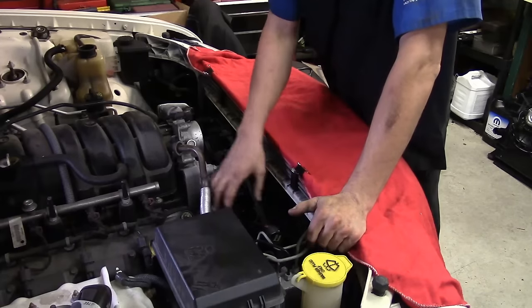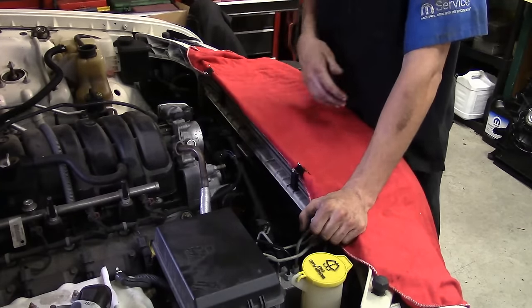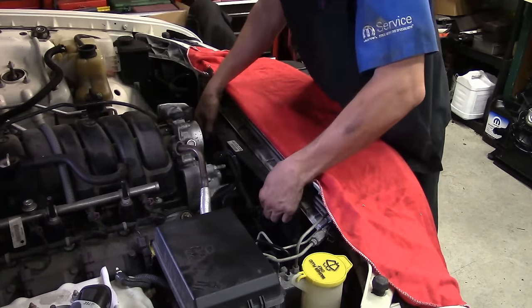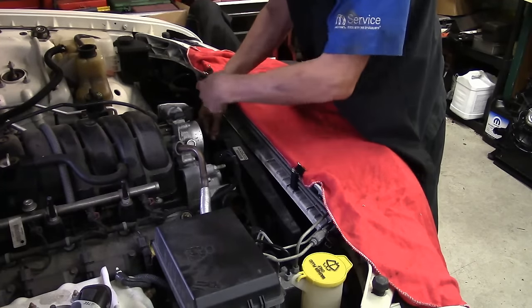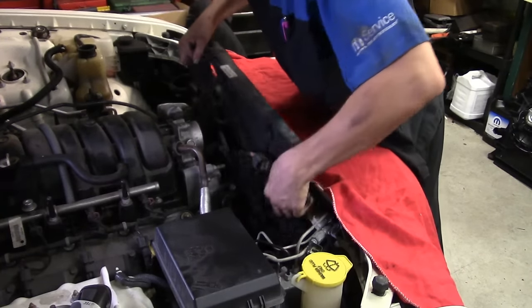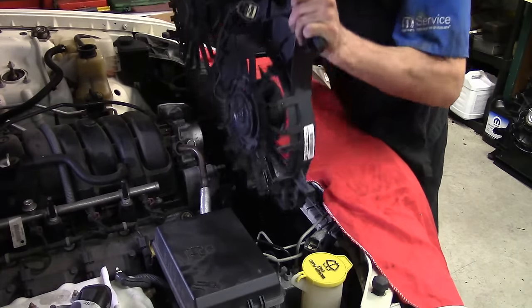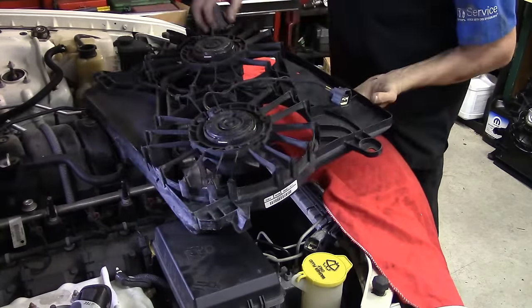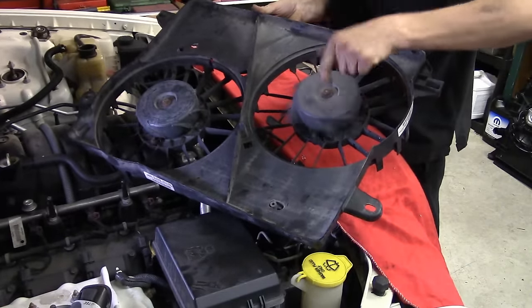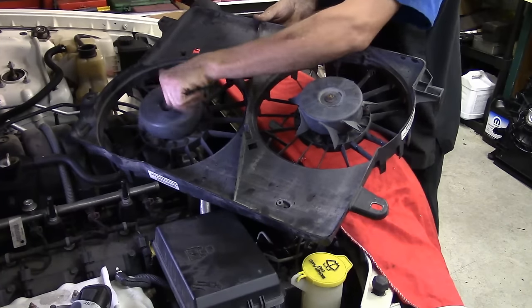So where are we? We've got the upper radiator hose off, the two bolts holding the fan shroud removed, and the electrical connector disconnected. At this point it's just a matter of lifting straight up. We'll move it slightly to the passenger side because we have to clear the transmission lines over here. It can still be a tight space with the pulleys up against the motors — some of them are very, very tight, so just take your time. And there we go — that's our fan assembly off. If you notice on this side, there's something missing: we have no blades whatsoever.